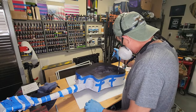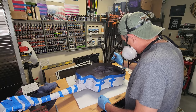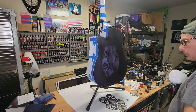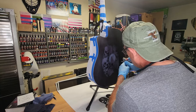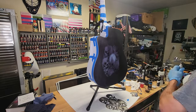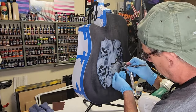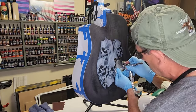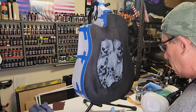I'm putting an inner coat of clear using the UVLS 4050 as an inner coat clear, because I want to redo the artwork with some Wicked White, and if you don't put this inner coat clear on, the candy will bleed through. I noticed I have some scratch marks because I didn't finish off with 400 grit, so I attempted to take the white and go over the artwork to hide the scratches — but I know better, you're not going to hide scratches with paint. So I re-sanded it down, wet sanded it with 400 until it was smooth.